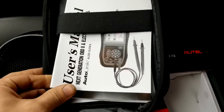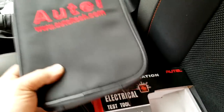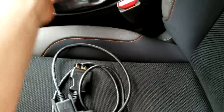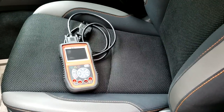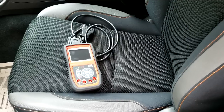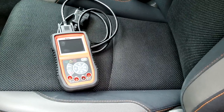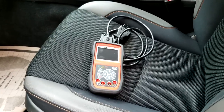I'm going to power it up and show you what it's going to do. What's also nice about this tool, it will check your starter to see if it's good, and it will also check your charging system. In just a few seconds we're going to use this tool to check this vehicle's starting system, check for emissions, check our charging system, and I'm also going to show you real quick how to use it as a multimeter. It's inexpensive — I'll throw the link in my description below.